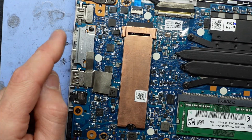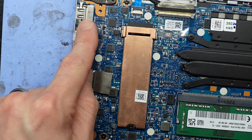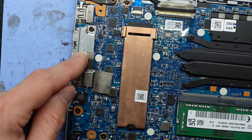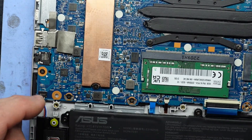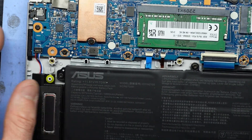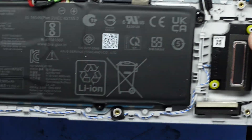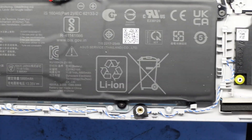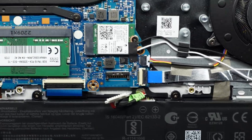Looking around the rest of it — actually, if you damage the charging port: this one charges on Type-C with two Type-C ports side by side and a bracket applying pressure, so you will need to do board-level repair if there is any damage to your Type-C ports. Looking across we have a downward-facing speaker, the battery as mentioned, another downward-facing speaker, and it looks like the Wi-Fi antennas are built into the bottom here, which I don't actually mind — they're in the plastic on the bottom rather than in the metal on the screen.